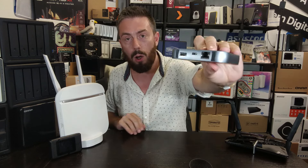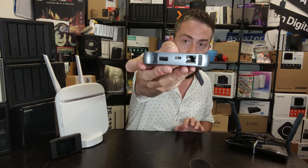This next one is a big point when it comes to connected internet connections and it really separates the pack with SIM routers overall. The cheaper you buy a router, the fewer — or even complete absence — of wired internet connections you get. Those are Ethernet or RJ45 connections on the rear. That means when you're using your SIM router on 5G or 4G and getting that lovely internet connection, you might not be able to share it via cable.